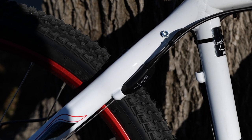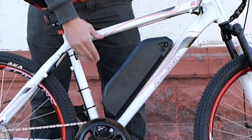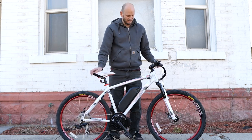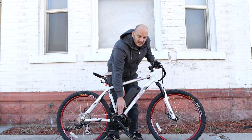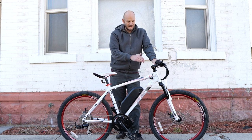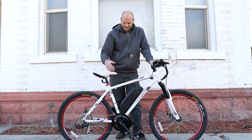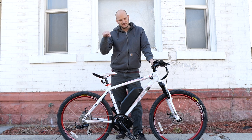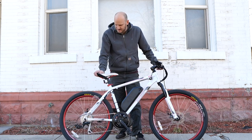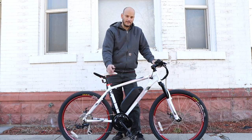I've got a gear shift sensor here — the cable that comes off it and connects to the controller is perfectly stretched out with no excess cabling. This bike didn't have a lot of excess cabling almost anywhere, so I was really happy with this build. It came out fairly clean and was actually a really easy motor install. A lot of times you need spacers or adapters or something's wonky, but this bike — if someone asks what's a good easy bike to convert — it's got a kickstand mount by the seat tube so you can run all the cabling down there. Love it when bike frames have that. It's got an 8-speed rear with roughly a 34 or 36-tooth cassette, so about a 44-to-34 ratio — not quite one-to-one in the lowest gear, but hill climbing is still great.